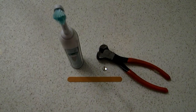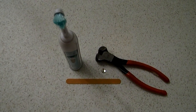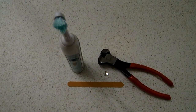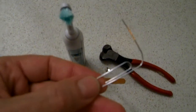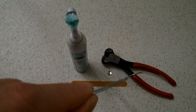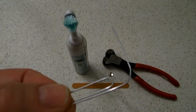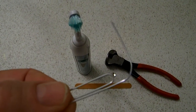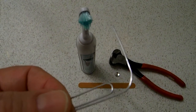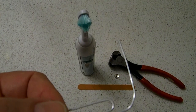After reinstalling the toothbrush handle, the switch would not engage with the handle back on by pressing the rubber switch. So I unfolded a paper clip and used the extended end to engage the switch directly. It worked, and it gave me an idea of how long a pusher rod I needed to engage the switch through the rubber.